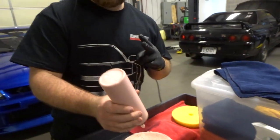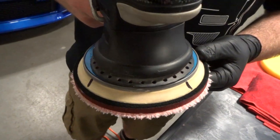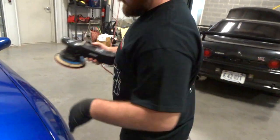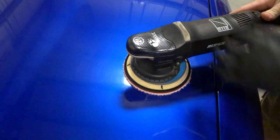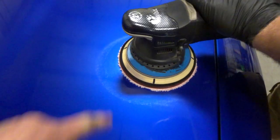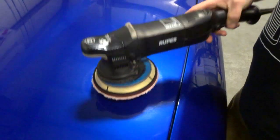Donnie has lines on his polishing pad. The lines are there to make sure it's always spinning — because if you ain't spinning, you ain't cutting. With too much pressure, you can see the lines aren't rotating, just vibrating. When the pad isn't rotating, it's not cutting — it's not doing enough.